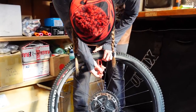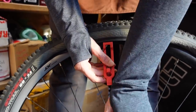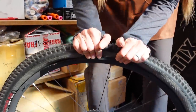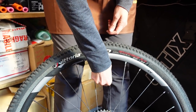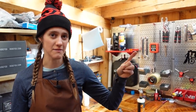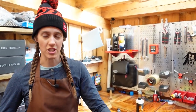When you're using a tire lever, don't wreck your rim tape — be gentle and don't do it right over a spoke. I'm going to go ahead and pull out this valve core. We are going to use an air compressor to fill this up right now because we have one — that is one of the joys of having this amazing workshop. If you do not have an air compressor, you might want to head over to our video where we share our secret for installing tubeless with a floor pump. That trick works just as well with a liner.